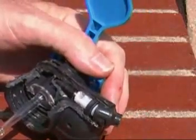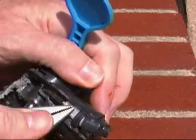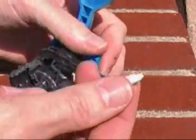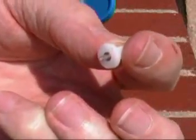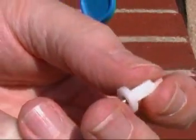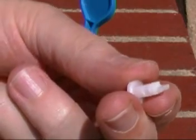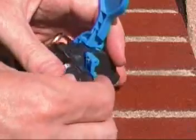Now we're going to disassemble this. Now that we've removed that rubber bushing where the CO2 cartridge was held, this is the piercing pin and the associated plastic part that holds it. You see that hole in it? The piercing pin actually has a slot in it, connected to this piece of plastic that's got a hole in it. That's how the CO2 gets up from the CO2 cartridge into the rest of the unit.